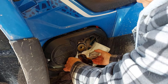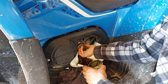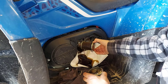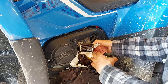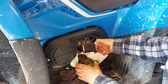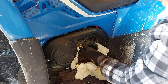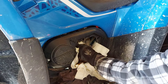Oh, that's a lot of oil. It's a good thing I put that rag here, but it's getting full. Pull our filter out and there's a black O-ring there. Holy smokes, that's a lot of oil. Looks like I'll have to clean up a mess — maybe I'll get more paper towel. This black O-ring, you're going to need that as well. I'm not replacing it every time; I'll reuse this one. The filter is going to get changed. I got an old glove and a paper towel, just going to clean out this dirty oil out of here.